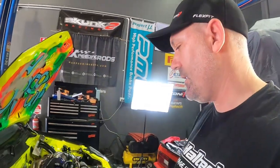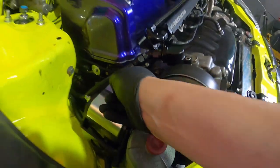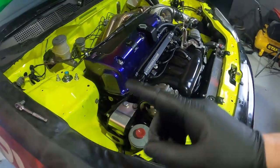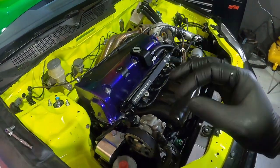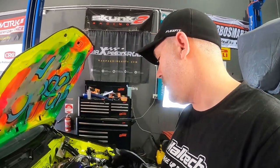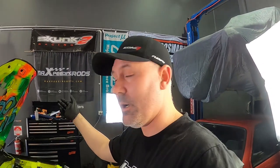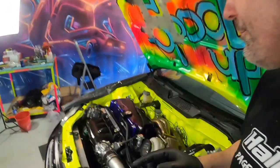One thing to mention — and I'm sure someone in the comments will pick me up on this — there is a little cover just down here in front of the power steering pump. It's a little two-bolt thing with a gasket and a small gauze inside. To do this job 100% properly you'd need to pull that off, clean it out, and replace the gasket. I'm not doing that because I'd have to remove the idler pulley, the engine mount, and the power steering pump. Fight me in the comments — I know I should, but I'm not.